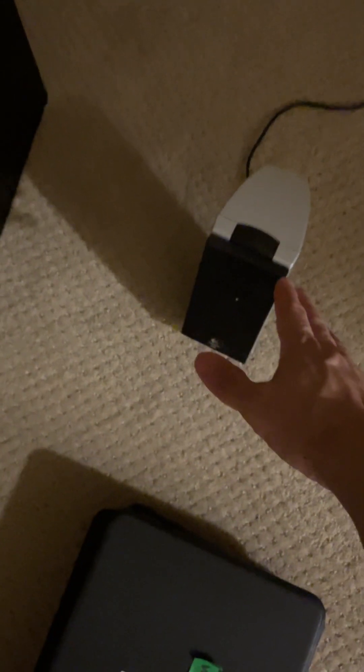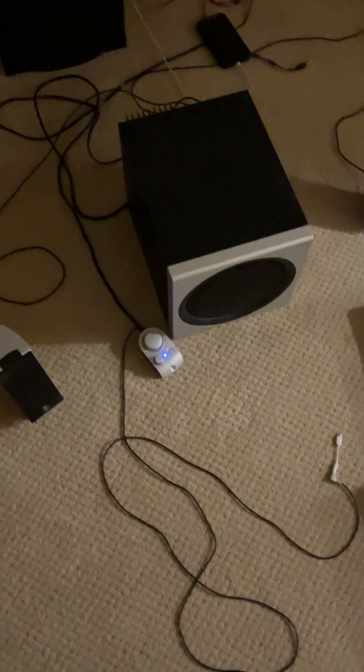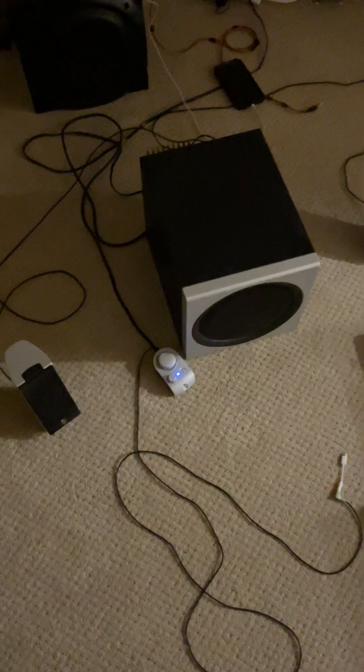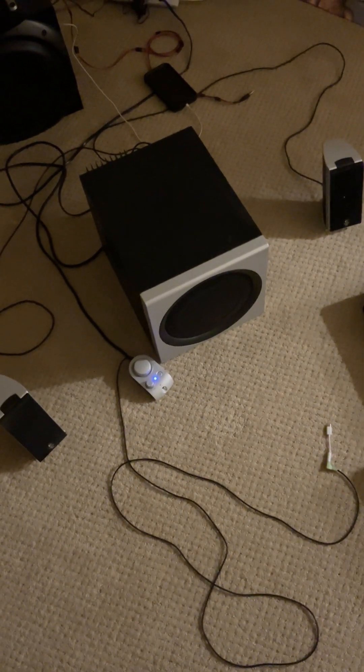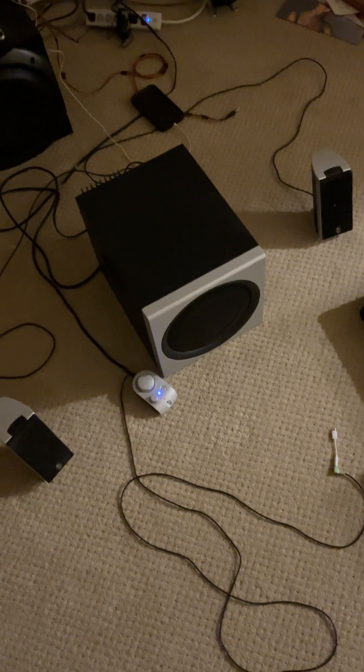Here's the finished product. The speaker on the right was good to begin with; the speaker on the left is the one that we fixed. Admittedly the job doesn't look perfect, but I ran it with a one-minute audio test on YouTube — I'll put the link in the description — and there's no buzzing, no rattling. The sub sounds great, and all the frequencies are showing up fine on both sides. You really can't tell the difference. This is a little cheaper than buying a new speaker or replacing the speakers on both sides, and we retain the THX certification by keeping and repairing the original speaker. Hopefully if you have a similar issue, this gives you at least one option for how to repair your Logitech Z2300 speaker system.